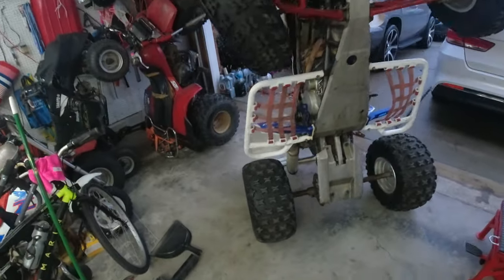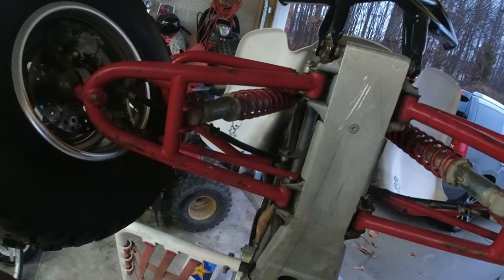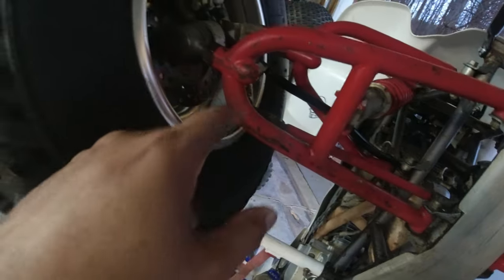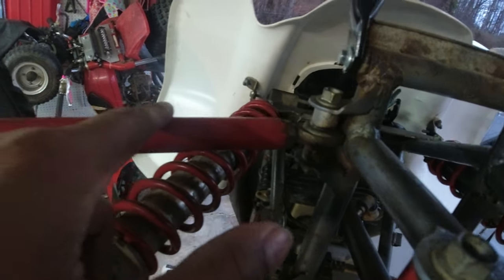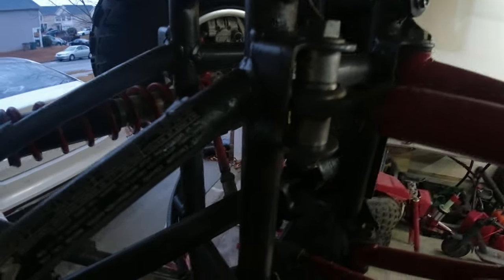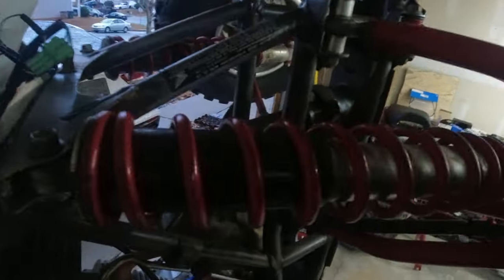First thing that's wrong with it — these are the Wicked Products plus-two lower A-arms. I can't even find their website to look up rebuild parts; you can't find the ball joints or anything from that company by part number. The heim joints on the passenger side have major play — they rock back and forth, which you can see if you hold them.